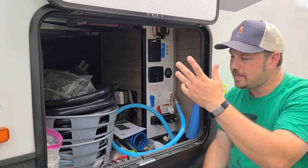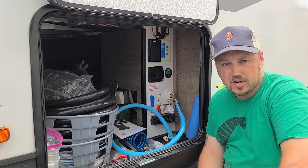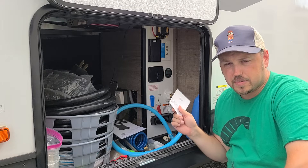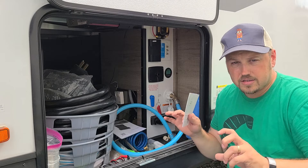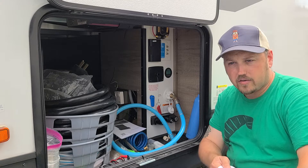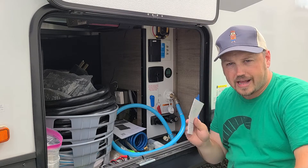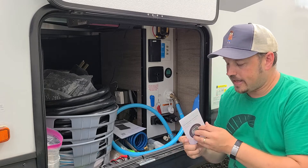This is important: if you come around the corner, open your bay, and see it saying 100%, well that's 100% compared to what it's looking for. If your battery was not set up for this monitor, you might only be at a real 75% or 50% charge. Whatever battery was put in, it's going to default to some preset and it won't accurately measure that capacity. So take a few minutes and go through the manual.